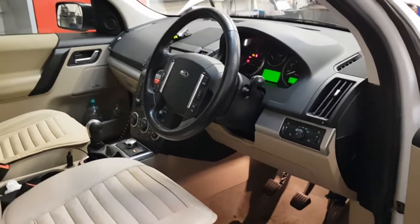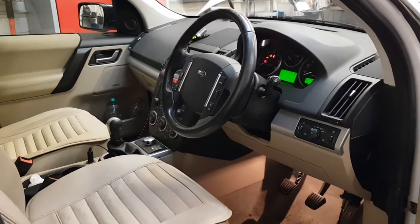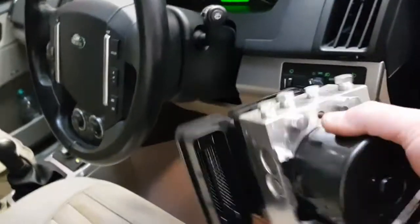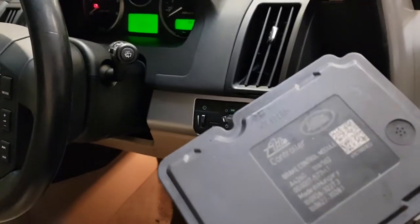Like I said, I didn't even know whether this would be Teves or Bosch, but once I went to the control unit multi-plug, I knew it was a Teves module. So the module in question is that. It looks like a Teves MK60 variant. Doesn't actually say, just says brake control unit.